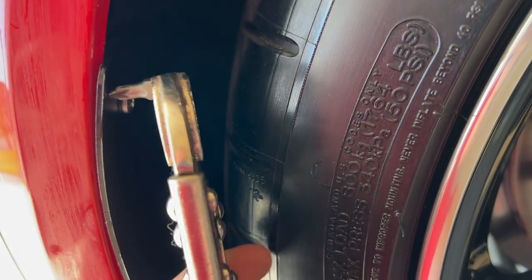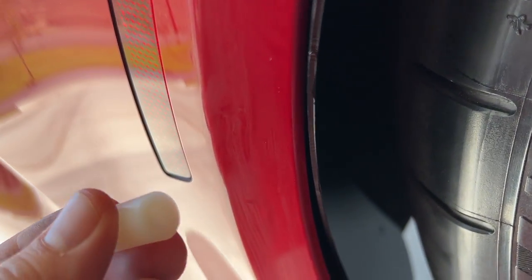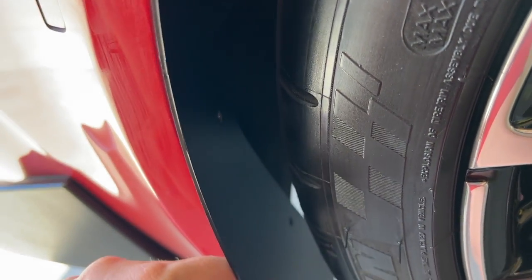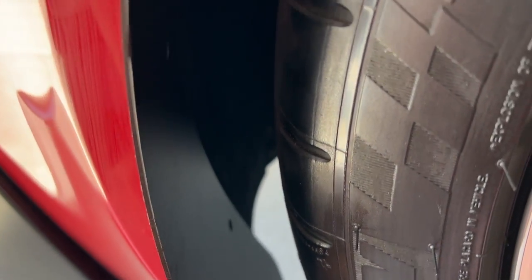We're not making light-years of progress but going turn by turn and it is actually working pretty well — this has been the fastest method I've seen. The spacers go back behind the rock guard, the screw comes through the spacer into the hole, and you tighten it down. The reason to do the top one first is it lets you play around and get everything in the right hole. The top one is probably the easiest; the bottom is probably the hardest given the space.